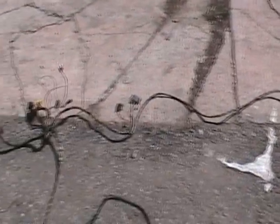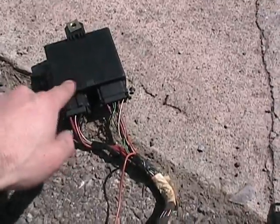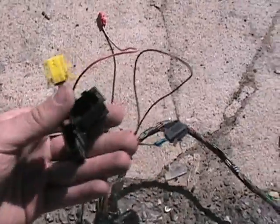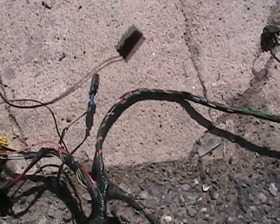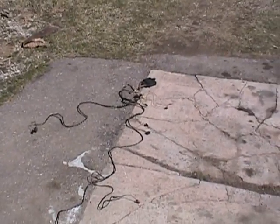I want to give one more quick example. This is the alarm harness from that 96 Golf I talked about earlier. Here's the computer — that lives up in the dashboard behind the air vent and the light switch. Here's where it plugged into the Central Electric 2 system, here's where it interfaced with the central locking, here was the dashboard switch, and this is where it got switched power from. Back here is where it would have plugged into the central locking pump. I didn't have to cut a single thing to take this out — it may have been lightly taped to another harness as it ran into the back of the car, but it was really easy to get out.